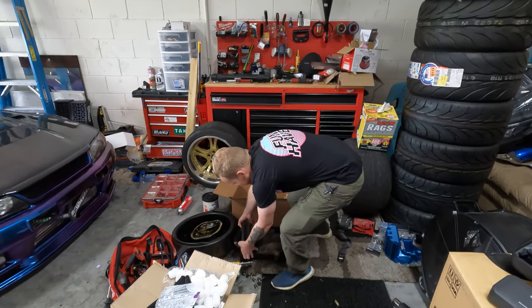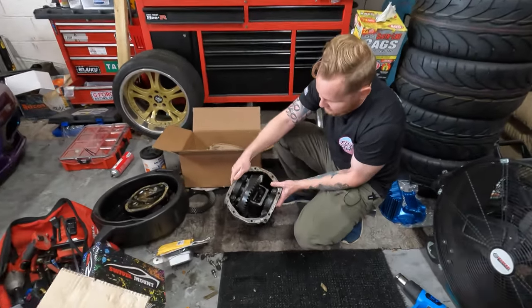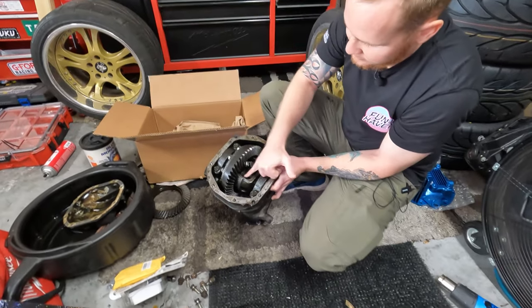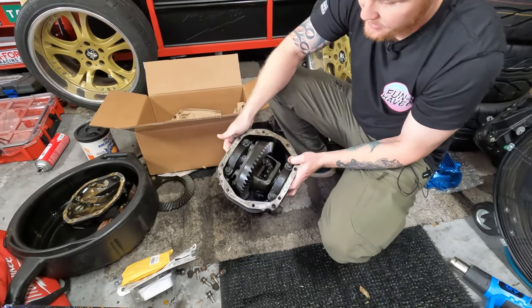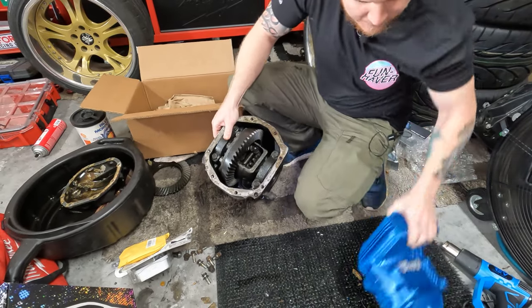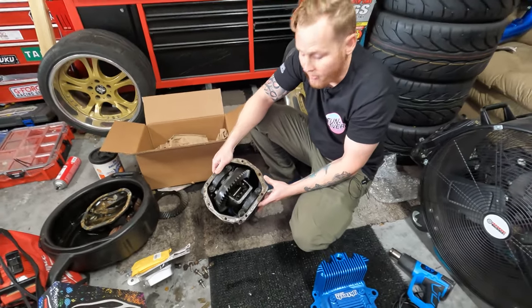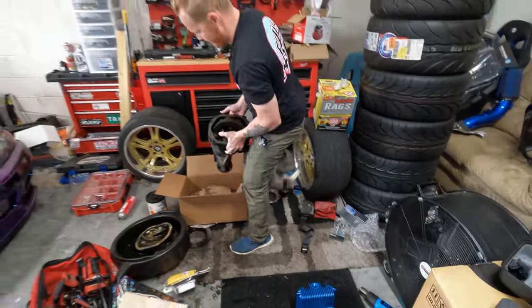So I've got the diff already opened up, taken apart. All the gears are in there. We just need to get these all welded in place and then we can close it up, put our GK Tech cover on there and fill it up with fluid, and then we'll be good to go and put it back in the car. So let's get this loaded up